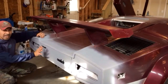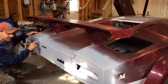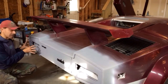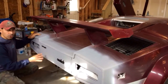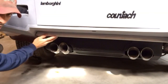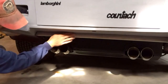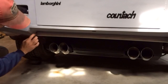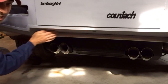Last time here in the garage we finished the back end rebuild. Just need to touch up a little bit — need to Dremel the contours a bit wider since I can't get the tail light pieces to fit properly. We're also adding the bull logo and the S logo on the back. Underneath, there's a PVC piece mounted to the body that's going to be the bumped-out section where the license plate gets mounted. There's a small gap where it was cut short, so we'll fill that with resin, apply body filler, smooth it out, sand it down, and prime it.